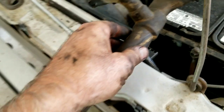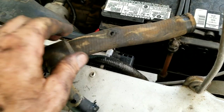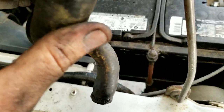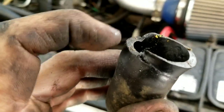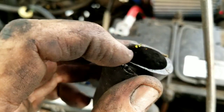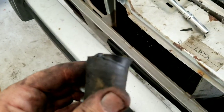I'm gonna show you what I did here. I had to take off this hose too — this one wasn't leaking but it was looking like it was gonna. This one actually was the culprit. What happened is somehow the clamp slipped sideways and popped off into the hose, and it kind of broke it. It looks like it was clamped all the way across and then a little piece of hose came off right there. That's how it happens.